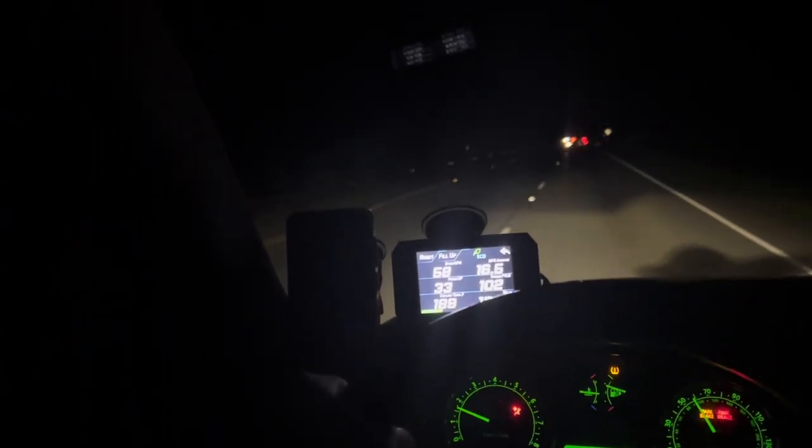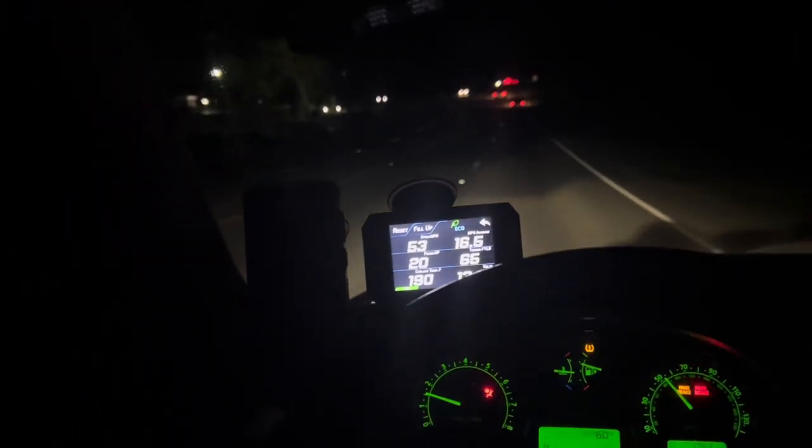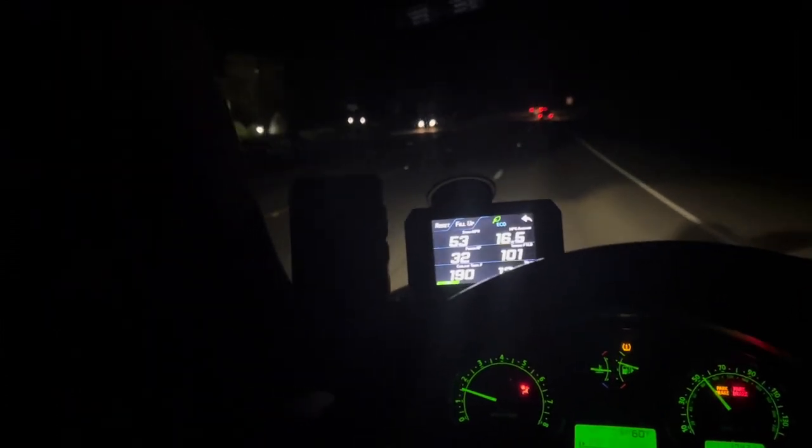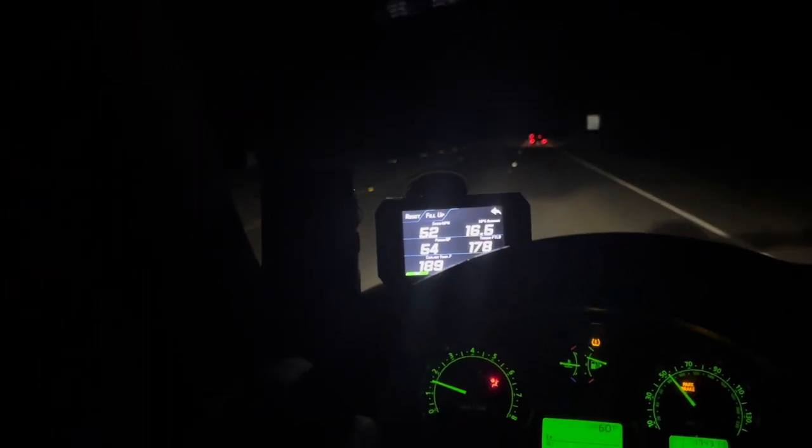If you do have an overheating car, you should turn heat on high, and basically spin your climate control adjuster into the red, and run your blower motor on high. That way the heater core can open up and the water can properly circulate and cool down the engine. So that will definitely help.